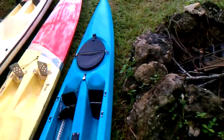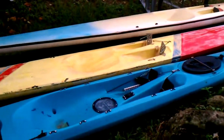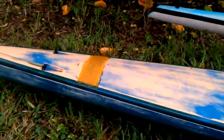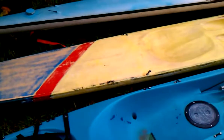I don't know if you can see that flexing, but it's a very soft hull. So you wouldn't want to run into anything with it or come crashing down from a big wave. This one's already got two repairs on it where it's split — one is on the side and one is across the back. I'm going to end up keeping this and putting a hatch right in the back there, and when I do that I'll repair the inside of it and stiffen it up a little bit.